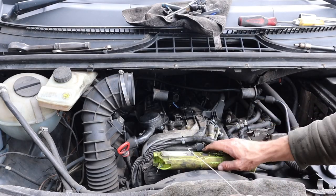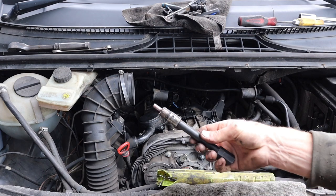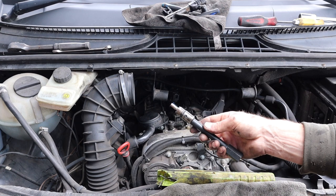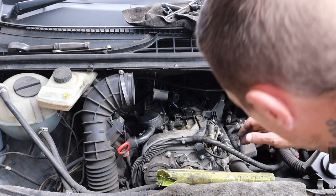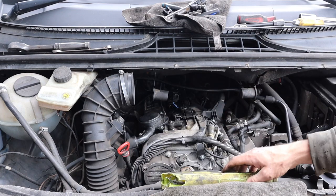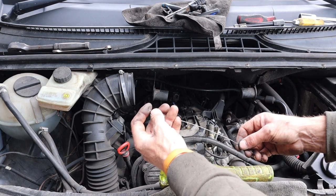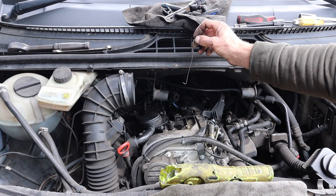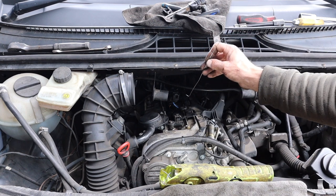Finally got all four out. The injector seat cutter actually pulled one of them out. The one in cylinder four was a pain — I could see it was loose using a mirror at 45 degrees and a torch. I used some welding wire bent into a hook about 10 mil long. It took about 15 minutes and I was getting frustrated, but I got it out. All four injector washers out — new ones have just turned up.